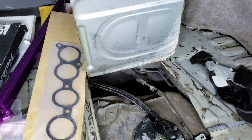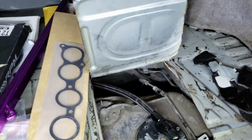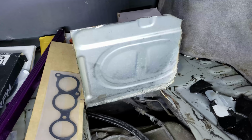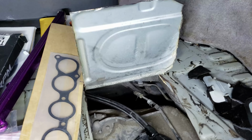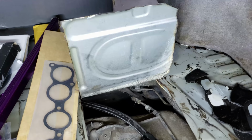Getting the engine and tranny bolted in finally, where it's going to go. I need to pull out the engine, pull out the tranny. Need to bolt the front crank pulley down. Need to put the flywheel and clutch assembly on the motor. Get the tranny on the motor. I'm going to put that in as one unit. Bolt that in. Fuel system will connect to that.